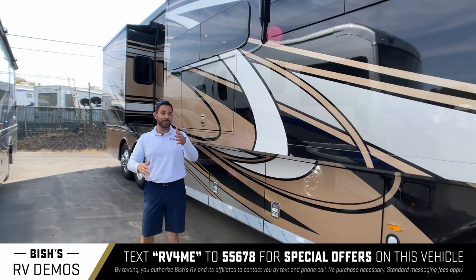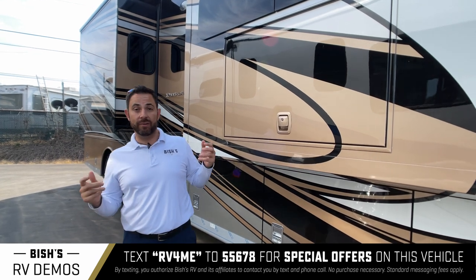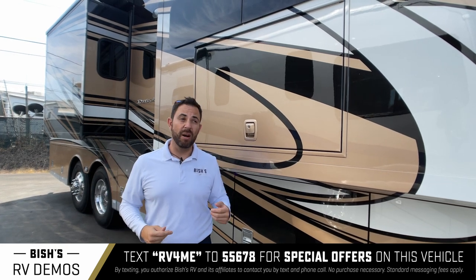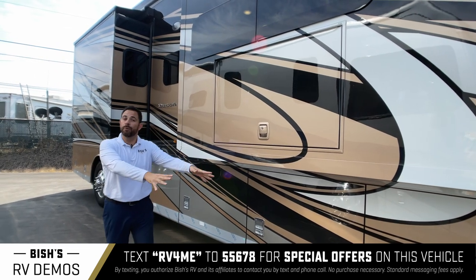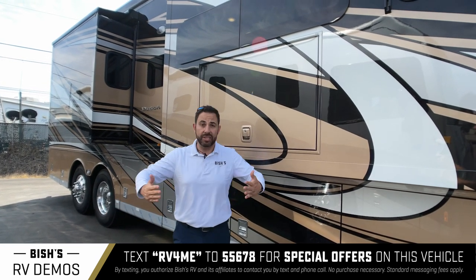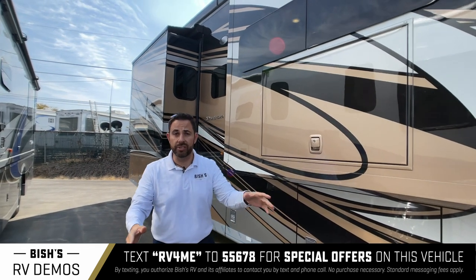Quick quiz: what does passive steering do for the Dutch Star? Ding, ding, ding. Gives you a tighter turning radius. That rear tag axle cants inward when you make your left and right turns. So those wheels canting in give you about 16 to 17 extra percent wheel cut. That means a 40-foot coach driving into a left or right turn is like turning a 33-foot motorhome into that turn. That's how much extra wheel cut you get. That alone is huge, with that already 55-degree wheel cut, 60 degrees on some coaches, that you get up front from the standard steering wheel.